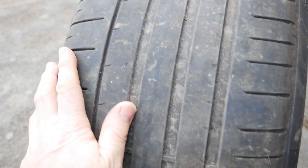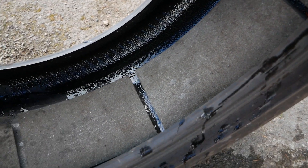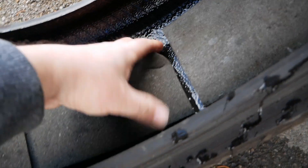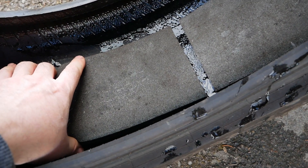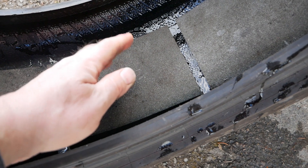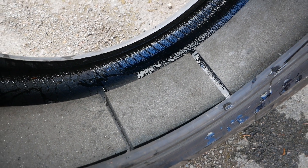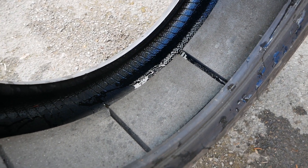One question that gets asked a lot is: are they repairable? If you get a screw or nail in your tyre and have a puncture, are foam-filled tyres repairable? The answer is yes, but it requires a bit more work. You have to cut out the foam — you need a knife — remove the relevant block of foam, patch the tyre as normal, and then glue that foam back down. The reality is a lot of tyre places don't know how to do it or don't want to, so they'd rather say no and sell you a new tyre. But if you find somewhere willing to do it, it really isn't that much different to any other tyre.